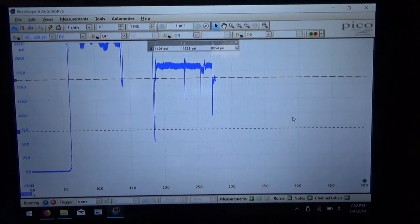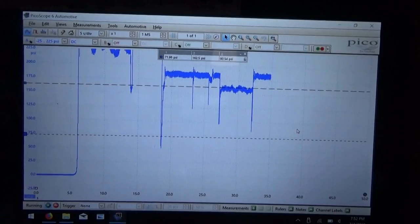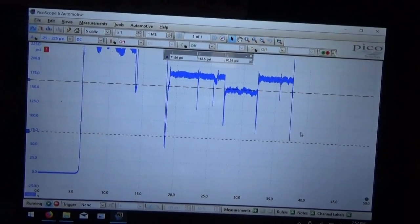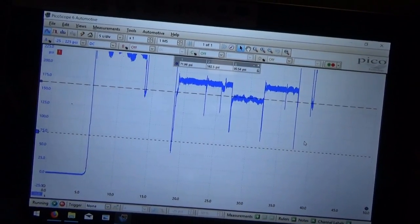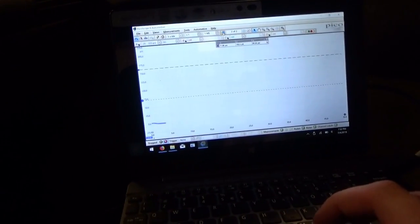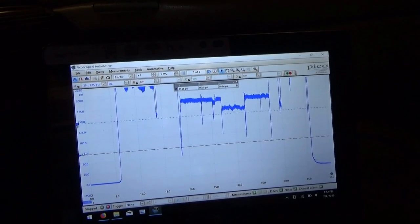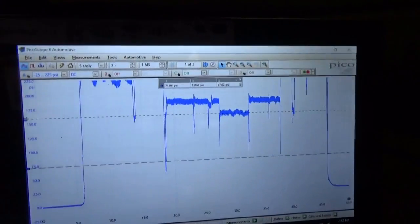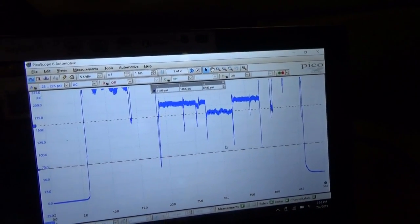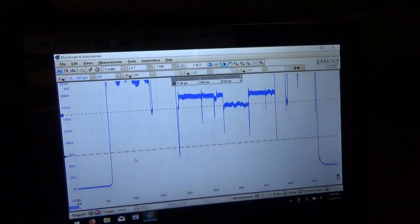In 2 and 1 — that's all the way. D, D, neutral through the roof, reverse — big — and park. Shut her down. You don't want to run it without that vacuum modulator for too long. So back it up — let's see what we have. Right there we got 160 PSI. It's a shame that we went off the chart, over 225 PSI.